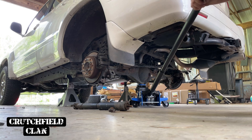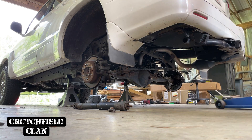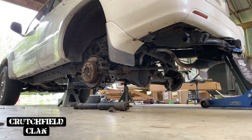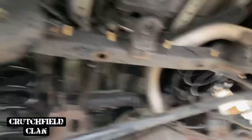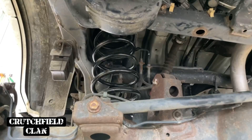And now I can lower it. Now I've got full range. Just because I like extra support, I put the jack back under the back end. I'm going to get my other jack - give myself some playing room to get these springs out, because that's next. I'm going to jack up one side and pull the spring - I'll see if I can get it without jacking it up. But anyway, these springs have to come out and the larger, heavier springs from Dobinsons will go in.